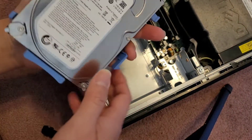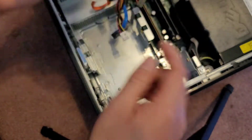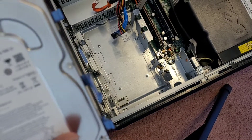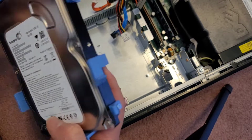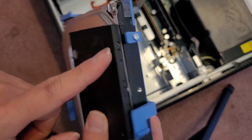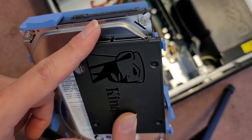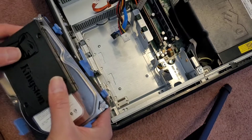I'm going to be leaving the old drive out, and we're just going to be putting the SSD in here. I actually cloned this over to a two and a half inch SATA SSD. If you want, you can find a screw that'll fit and possibly attach it there, but it doesn't extend out as far, so I'm probably just going to have to connect the cables and leave it somewhat loose in there.